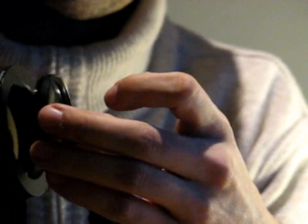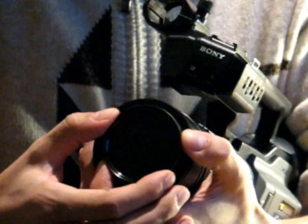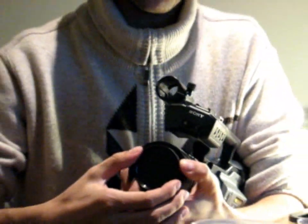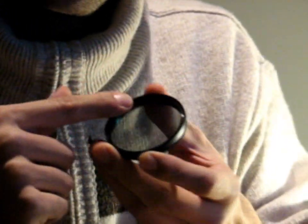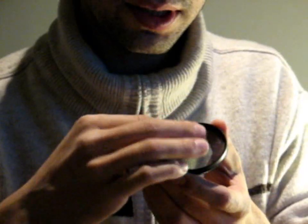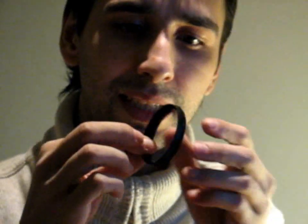The next part we are going to use is the circular polarizer lens, which is 55mm, and it goes exactly to this mount. That will allow us to rotate the DOF adapter once it is mounted. You need one modification done to it: you have to unlock the lenses inside, unscrew the holding ring, and take off the glass. Because actually you don't need the glass — you are only using this part in order to move the DOF adapter.